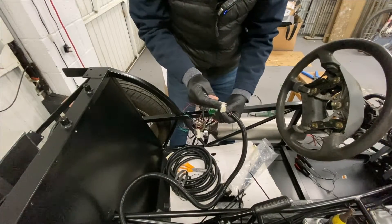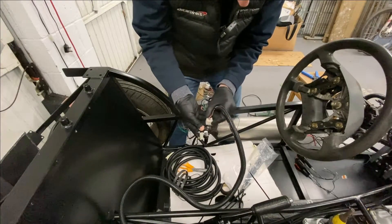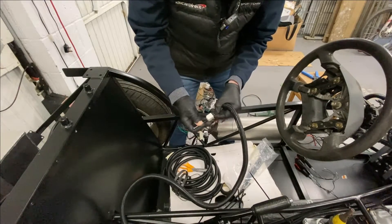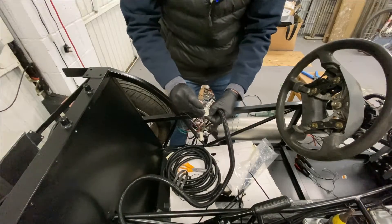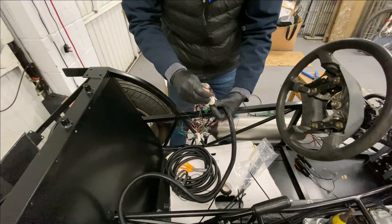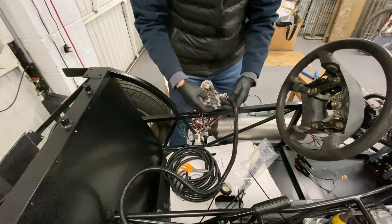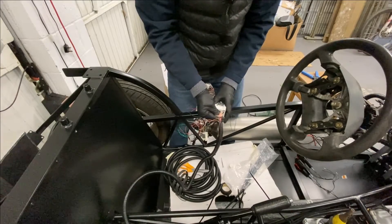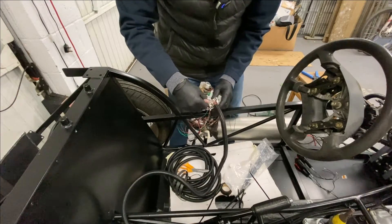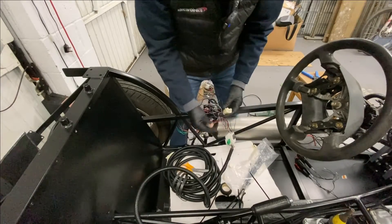What I'm going to do first is unpin these two. The way you unpin this particular pin is it's got a little bit of plastic — like a little catch. So you just need to get in there, lift the catch up, and then they come out like that. It's not something I can easily explain how to do. So I'm going to put the grey-red wire in the far right-hand one, and then the red-yellow in the second one in. And then I'm just going to repeat that with the other plug to eliminate that plug as well.